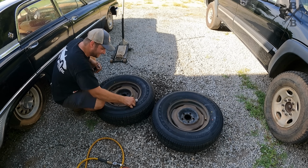And there you have it, first wash in at least 24 years. Obviously went a little bit farther with buffing and waxing it. We did wet sand some of the top panels. In the near future, we could go through, and this side's really nice. The other side does have some orange peel. We could do some more wet sanding, some more buffing and waxing, and really dial this car in. But I'm really happy with it, and I hope you all are too.